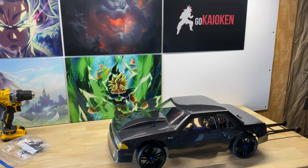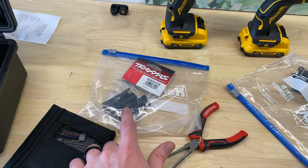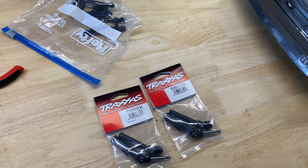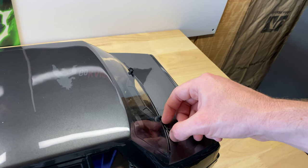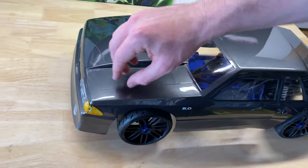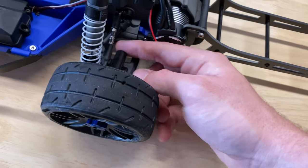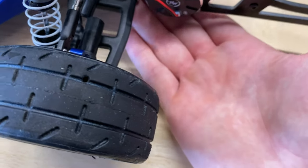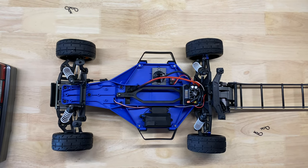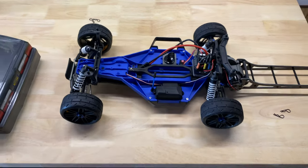This is going to be my car when I want to go out and just ride and look good. But when I want to go for high speed runs I'm going to get the slash body and put that on. The half shafts I got before - 6850 - were too big, so I did have to go get two of the slash drive shafts, part number 6852X, and those are going to replace the bandit drive shafts. The bandit drive shafts were just a little short, so the rears will be just a tiny bit wider than the front - I'm fine with that. I was not okay with the fronts being wider than the rears when putting anything other than a skinny tire up front.